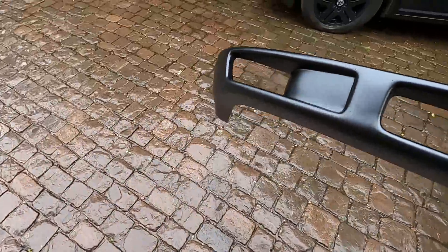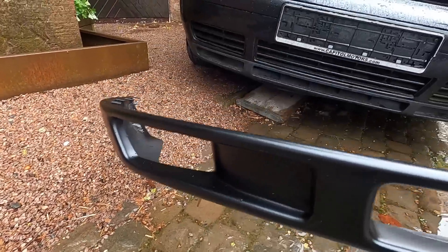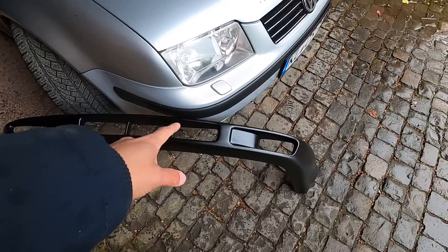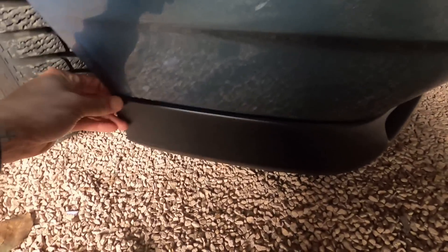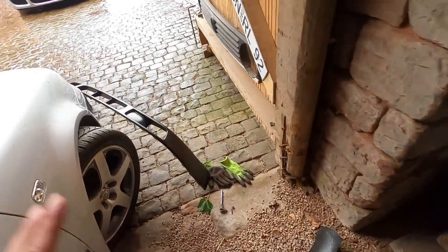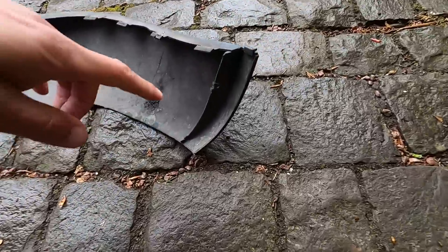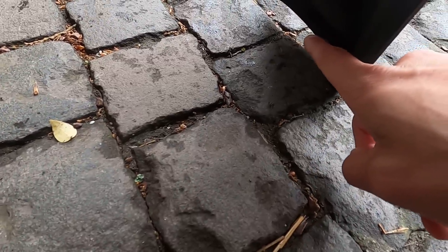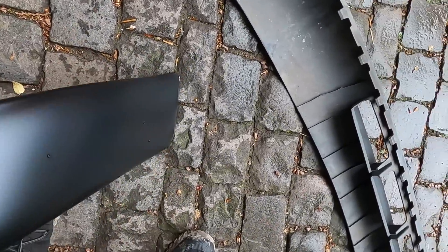One down — this thing looks so good on the wagon. I'll put it next to the OEM four motion lip so you can see: it's similar to the factory four motion lip except these are actually open where those ones are closed, and this one's a bit deeper all around. This lip did come with hardware to actually mount it to the bumper. This lip over here is also a Rieger lip — one-piece construction — it came with hardware but I didn't use it. I always run it no hardware and it doesn't move anywhere. The factory lips all have this little flat panel piece where you screw the T25 in, but Rieger just has a flat piece right there with no mounting tab.